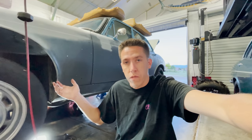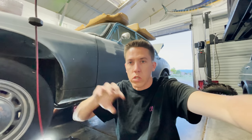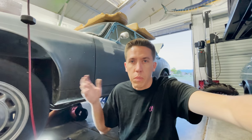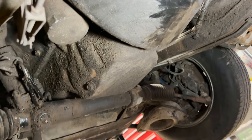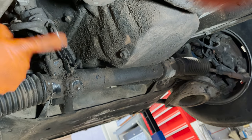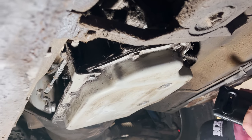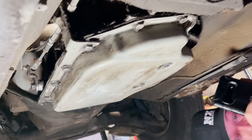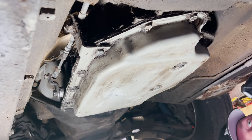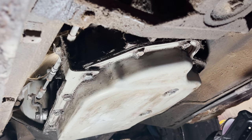We'll have to do some research on that, but this looks to be a turbo 400. That's still good — at least all the internals are good there. If anything ever goes wrong, we'd just go to a regular case one and it should bolt right up to the small block Chevy. We'll keep looking at it and see what else we can find, get it cleaned off a little bit. You can tell by the sheer amount of junk and buildup on here — like I just cleaned these lines off and they're pretty bad. This car has been driven. I would say we got the transmission pan kind of cleaned up. It does say 'Division of GMC' under the bottom of it. So it's looking like this might've been one of the four L80s that came in the Jags and then they dropped the 350 in it somehow, someway. These two came together.